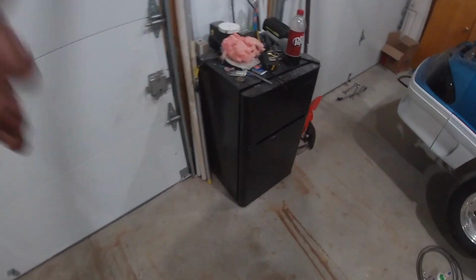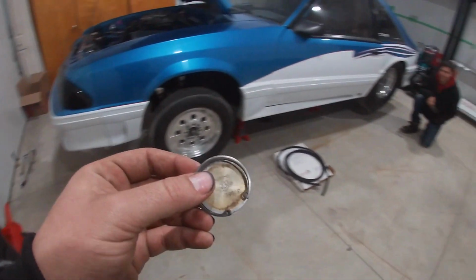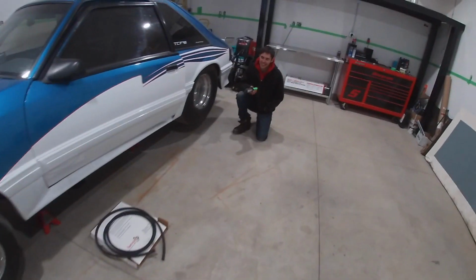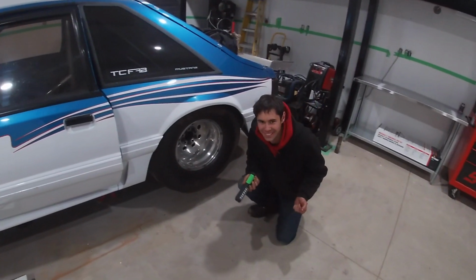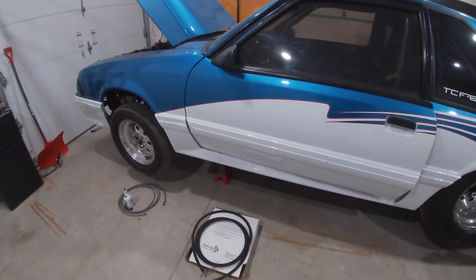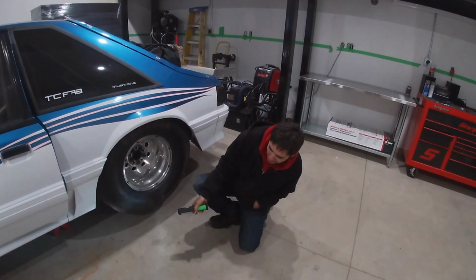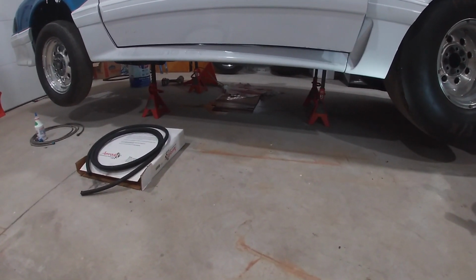We also have to put this back in, because apparently pushing your car outside breaks parts more than racing it. I pushed the car one day and parts started falling out. So I guess we gotta address that. We believe the source of that was the output yoke of the transmission, because we now have a slight leak of transmission fluid. Yeah, it's quite the puddle. That's a mess.